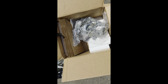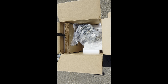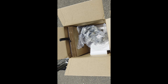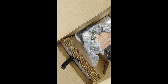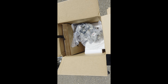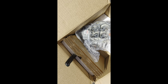So we'll be taking the idle box back off again and putting these Holleys on and giving it a go again. I tell you, it was pretty frustrating the first time of trying to make it work. It would only run if the accelerator was pumping fuel. If those were squirting out fuel, that was the only time it would run. There was basically no idle. You were running at 2,500, 3,000 RPMs, and it would die. Like I said, if these weren't squirting, it wasn't going to run.